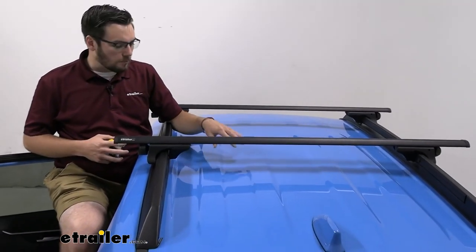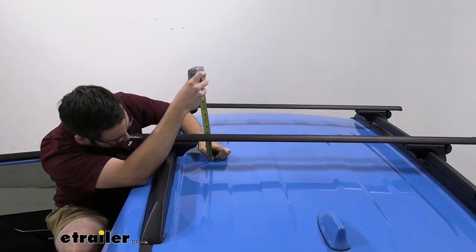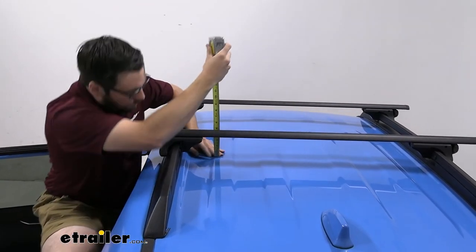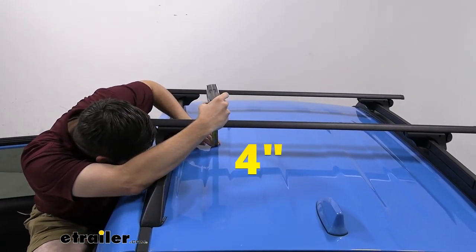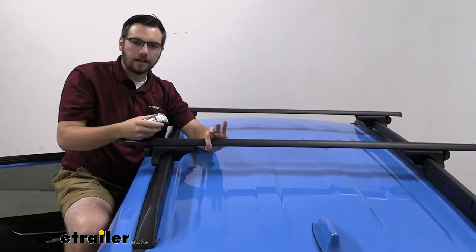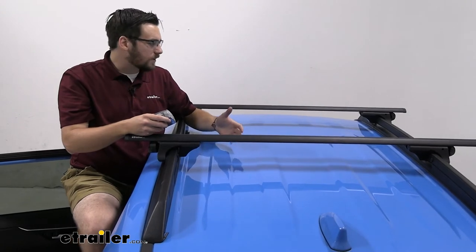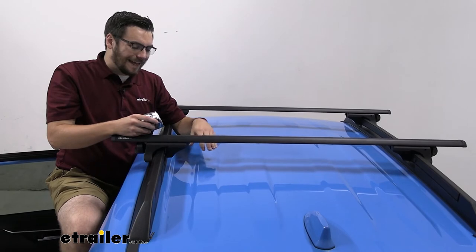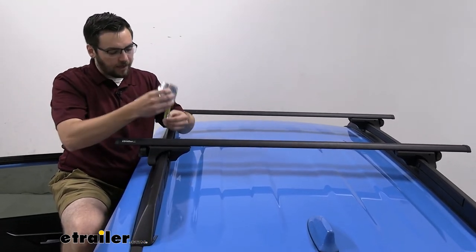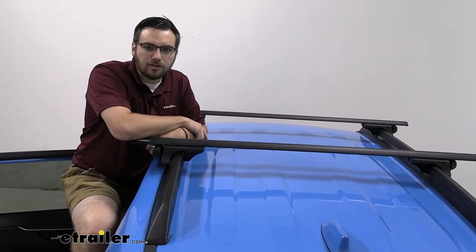Taking a look at dimensions: from the top of the corrugation on our roof to the very top of the roof rack system, we're looking at about five and a quarter inches to the very top. Our clearance at the bottom is going to be right at four inches — maybe a sixteenth above that. So there's plenty of space for a lot of accessories. A lot of mounts just clip right to the top, so I don't think we need a really deep well here. A big part of that height is coming from the raised rail system on the RAV4, so we're already a little higher up. The rack itself is adding just under two inches. I definitely like that — it's not too shallow for accessories and not adding too much height overall.